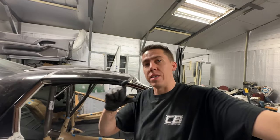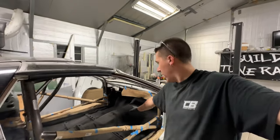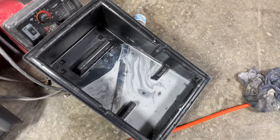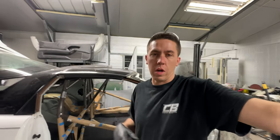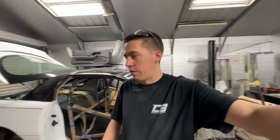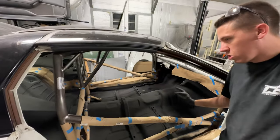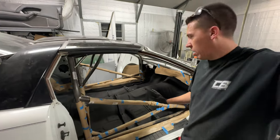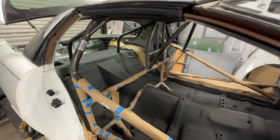I still have probably two inches left in the bucket, so I'm super happy. I can always come back and second coat the firewall. I did spray a little extra thick on the tunnel and firewall just to help with heat. Got a bit of a mess with water, but cleaned up everything, ran water through the gun, wiped off the mixer, and put the leftover back in the bucket. That is Lizard Skinning the interior of the Camaro — I think it looks super good. Kind of almost OEM style, nothing crazy. When you look into the car, it just looks good, looks nice and clean, helps the white pop on the outside.